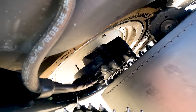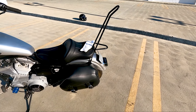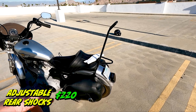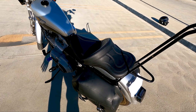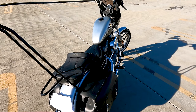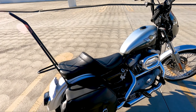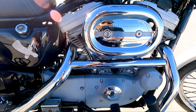You can't see them right now but for the rear suspension I've got touring suspension because I do a lot of two-up riding and I need that. I got those off Facebook Marketplace used — about 220 bucks for both. It's the one with a big adjustable shock on one side and a smaller shock on the right. Makes it stiff for canyon riding when I'm by myself and handles having a passenger great. I leave it at the first click, no preload at all.